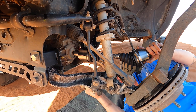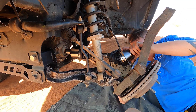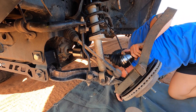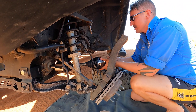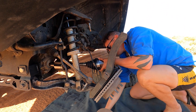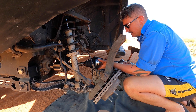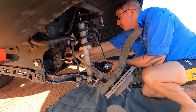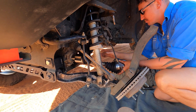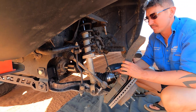This is where it's got to go in past that O-ring, and you've just got to be careful that you don't try and smack it on the rubber because that's when you end up pinching the rubber. So just come all the way back out, get on the end of your shaft. I think that's gone through - that's punched through. That's all it takes - not a lot. If you've got to smack the crap out of it, it might not be lined up.